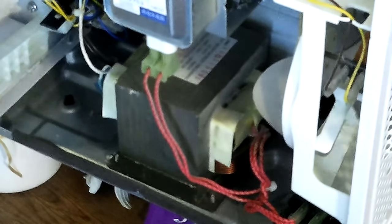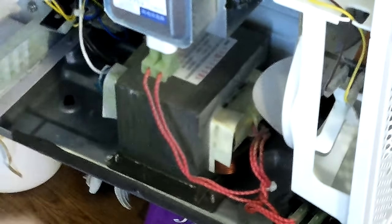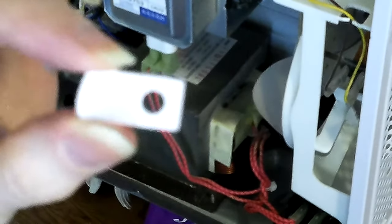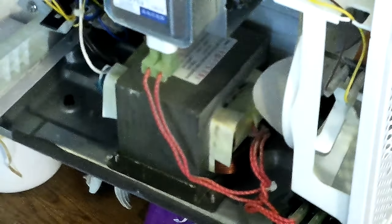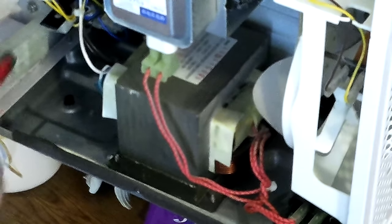The switch that opens the door has always been hard to turn, ever since it was brand new, but lately it was getting really hard — you had to hang onto the microwave and push as hard as you can. What it was: there's a small plastic tab that was holding the linkages on the inside, and it had broken off. There was no good way to put that back on — glue isn't going to hold under that much stress.